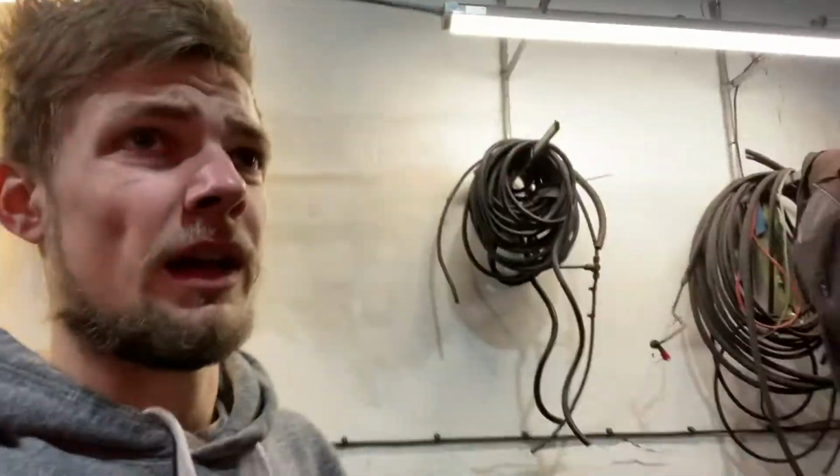Two rears built back up. Going to take into the front now. I'm probably going to strip the two fronts first because I need to go and get a set of spring clamps to take the top mounts off the two front struts. So I'm best getting both out first before I have to go and get them.